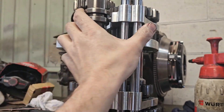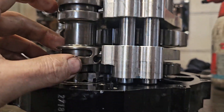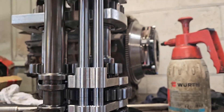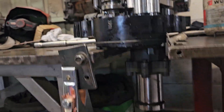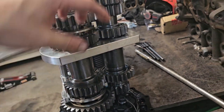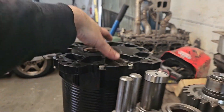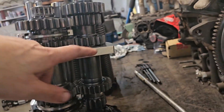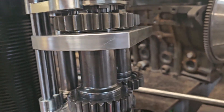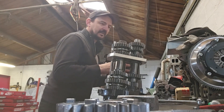What I was mucking around with - I had to get that lined up and that lined up so they're all in their grooves, pushed nicely onto the stack. They're all lined up and pushed back in by hand, so that is the gearbox reassembled. Time to chuck the casing back on. I won't lie - I had that plate around the wrong way. The bearings are the same size and you can get it around the wrong way. I noticed because I couldn't get it over the stack because it's offset, but it doesn't let you put it together wrong. All the dogs, everything's all lined up in neutral.